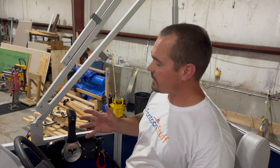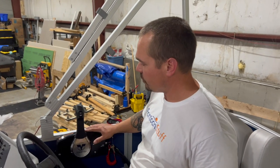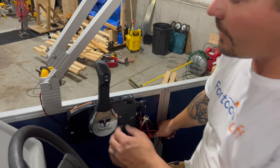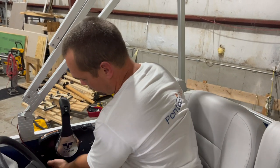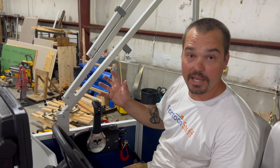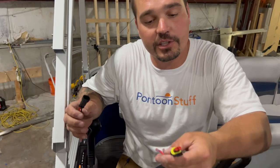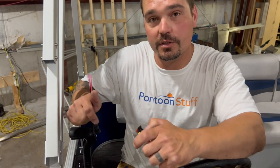Looking at the electrical on this boat — this is a side mount control box on the railing, which is pretty typical. What I can do is incorporate my wire right into the bundle of ignition cables and shift throttle cables running down through the floor. We'll use some corrugated tubing to make this a little prettier. I need to grab my gray with a blue stripe on my accessory harness and the corresponding black ground wire, and run them up through the hole for easier wiring. I'm going to use a waterproof quick connector in case I ever want to take the bimini right off the boat — I need to be able to disconnect my wiring.